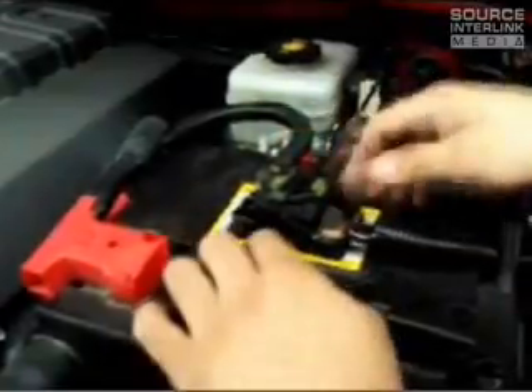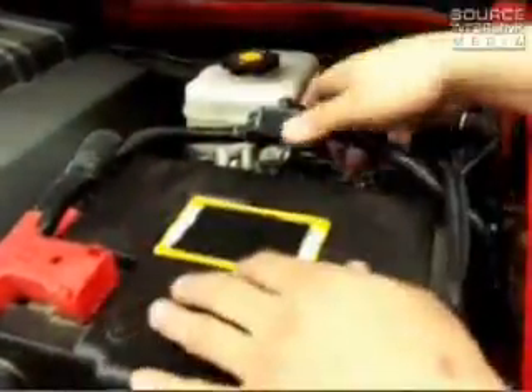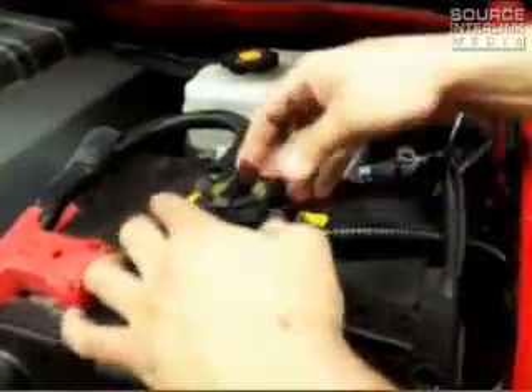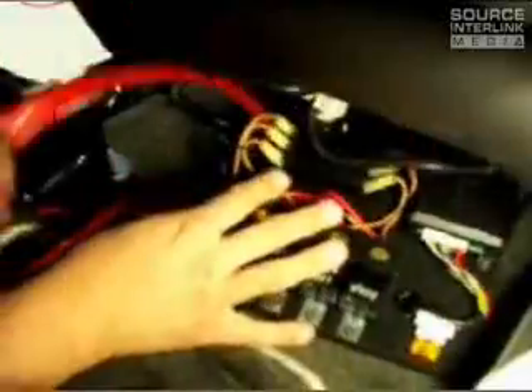This is the circuit breaker finally done. All the wires are nice and loomed. We got industrial Velcro so if it ever has to go to service, all you do is un-Velcro it, move it aside, take the cover off, service the battery, and then you can just pop it right back in place and turn it on — back in business. Right now I'm just putting in the so-called command center and I'm fishing all the 4 gauge — that main power lead that we need — and then running out all the output wires from the relay pack that's going to trigger the light.